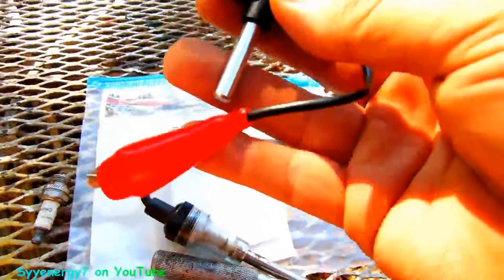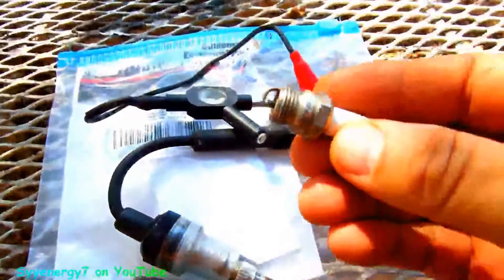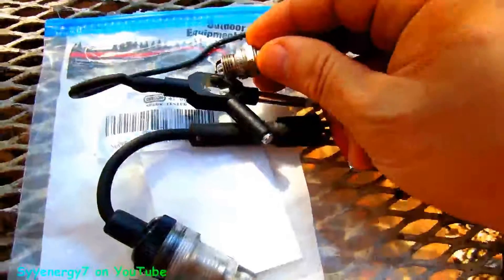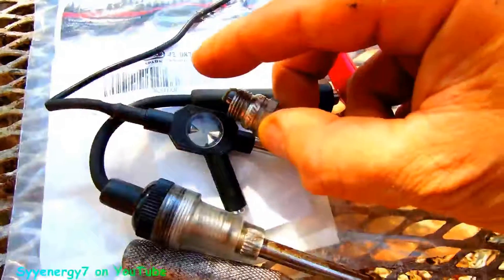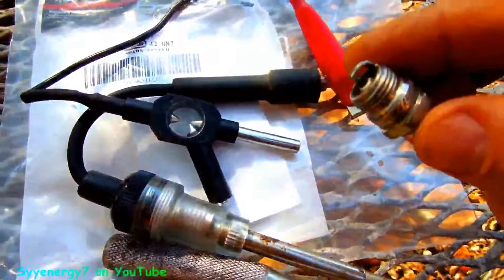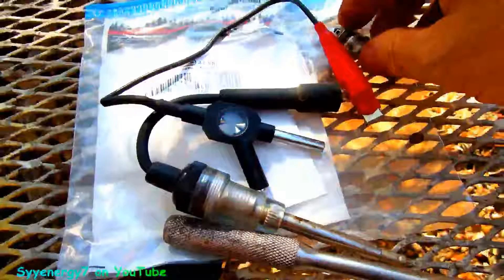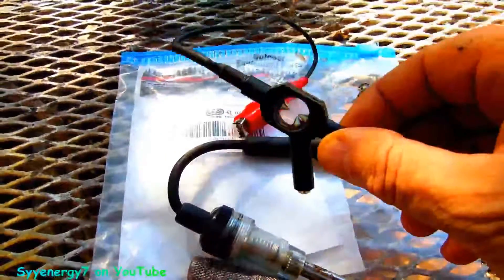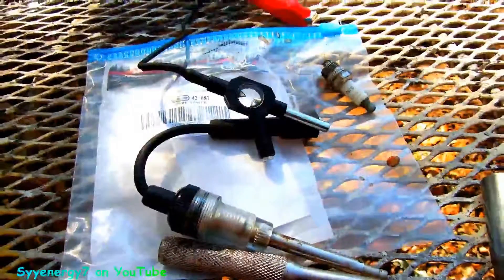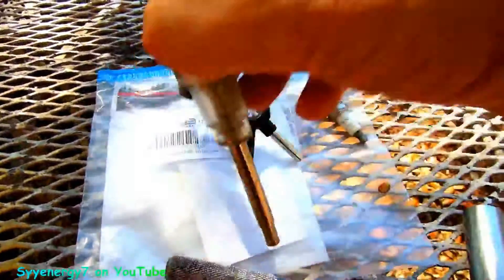This thing is not adjustable. It's probably not something you want to throw in your toolbox — it seems fairly strong but I wouldn't risk it, I'm gonna leave it in an instrument box. You can see how big that gap is compared to a spark plug gap. You can also take an old spark plug and bend the gap way out to about a quarter inch and see if it jumps. Basically this is like a no-go/go gauge for a strong enough spark. Depending on where you get it, about nine to sixteen bucks — a lot cheaper than the other gauges that cost sixty-five to ninety bucks with shipping.